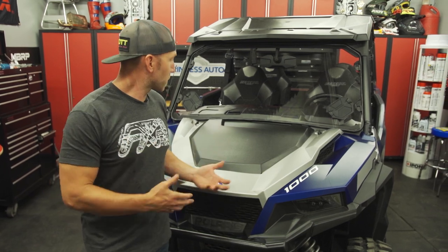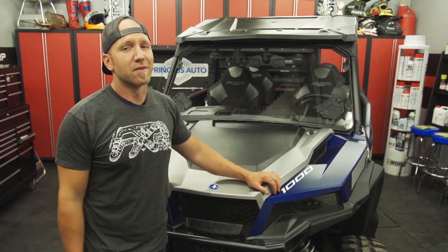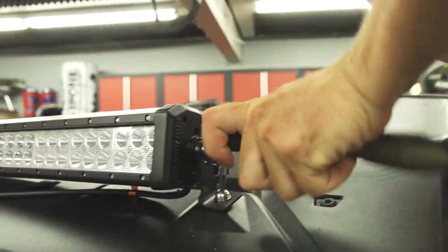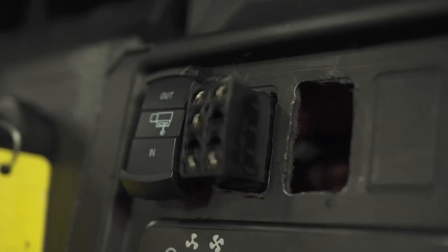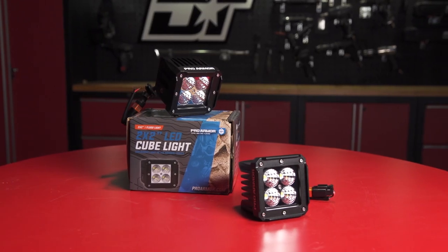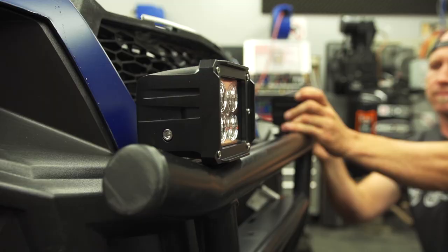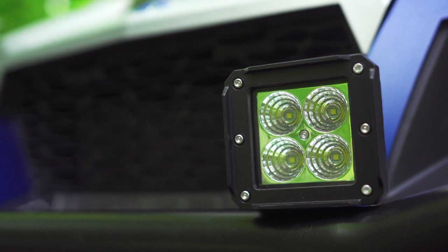This rig is pretty much ready to rock, but at this time of year the sun sets a little bit earlier and there's always a need for more light. With the Polaris Pulse system it's way easier to install — you just order the appropriate harness, click it into the pulse bar, hook the other end to your light, and install the switch. That is it. I'm using a pair of harnesses to set Luke up to light up the trail like midday with a 30-inch dual-row ProArmor LED light bar and two-inch by two-inch LED floodlight setup up front. All ProArmor lights are aluminum housed with a shadow-resistant lens, throw huge light, and feature adjustable mounts. With the light bar on the roof and the cubes on the bumper, Luke gets a perfect view of the trail way ahead plus illumination on the edge of the trail with the cubes. Both feature an illuminated switch and the rugged durability you'd expect from Polaris and ProArmor.